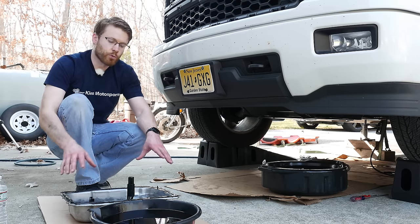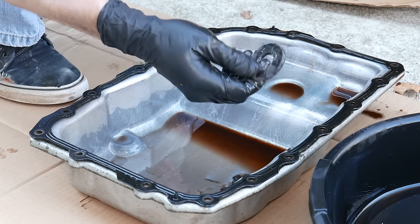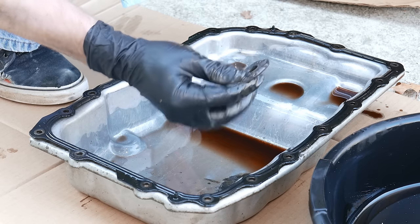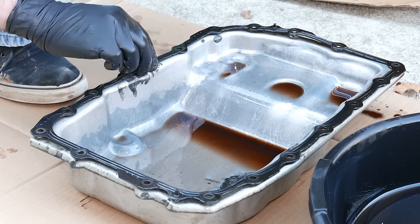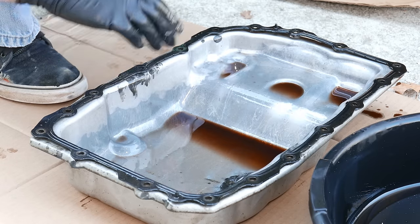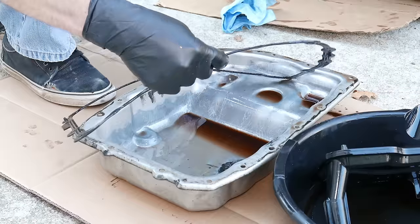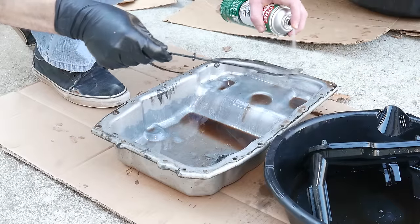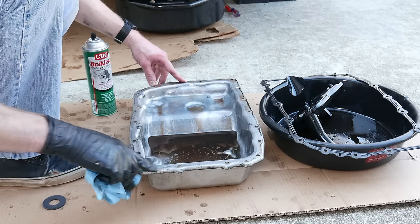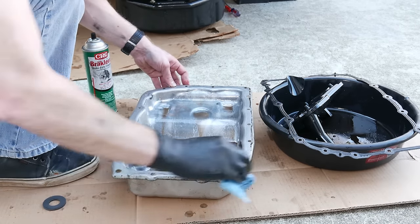What we're going to do now is clean this up, reinstall everything, fill the pan back up, and then run the pump again until we see the fluid color change. To clean up your pan, the first thing you want to do is remove your magnet and clean that up — it just catches any of the filings. This is actually in pretty good shape, a little bit of gunk on there but nothing I'd be concerned about — I don't see any metal filings. Next you want to go ahead and inspect your gasket. This is reusable but I would always recommend having an extra gasket on hand just in case it gets damaged in the process or you take it off and realize it's worn down. I'll leave the part number for the replacement gasket in the description. I'm just using a little bit of brake cleaner to spray this off. When cleaning the mating surface on your transmission pan you want to make sure it's completely smooth and doesn't have any etches in it — never use a metal tool to clean off this edge, because if you ever get a cut in it that could compromise the seal.